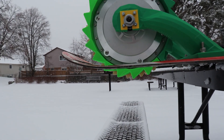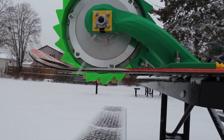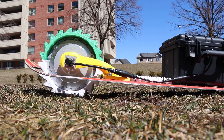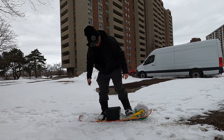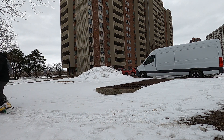I also had the motor mounting arms seating the wheel way too high in the first version, which meant it couldn't gain traction at all. So I redesigned them to seat the wheel a heck of a lot lower — well below the plane of the board — and with all of my weight on my rear foot, that forces the wheel right into the snow when I actually managed to gain traction.